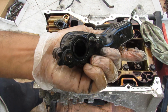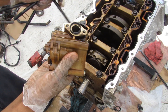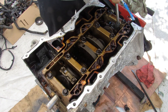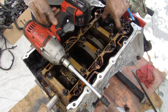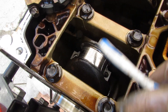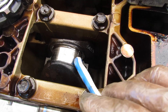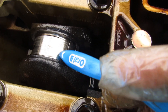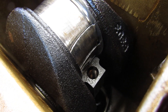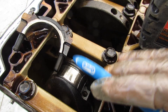Over here we've got this plastic oil pickup tube that draws oil down into the oil pump, which is driven off the timing chain at the front of the engine. There are a few particles in the screen inside of here. The oil pump is a fairly small compact style unit with an oil passage for pickup that pushes oil back into the block and feeds the oil filter. The connecting rod bolts are external Torx E12. There's no bearing on this side — the connecting rod cap itself is pretty black and burnt up, as well as the crankshaft in this region. What happened was the oil was starved, causing this bearing to heat up until it seized and rotated as the connecting rod moved up and down, doing damage to this crank. You can also notice just how thin these bearings are — they had to wear down quite a bit before they gave up and rotated. With no bearing on this top surface, there's now a gap, and that's what caused this engine to knock when running.